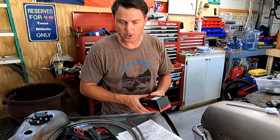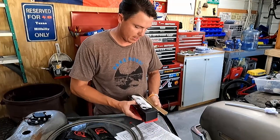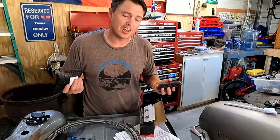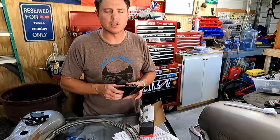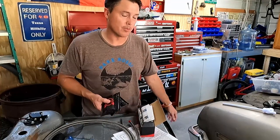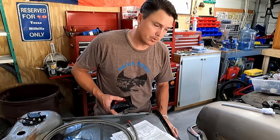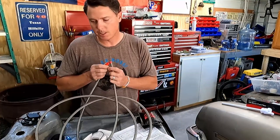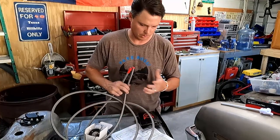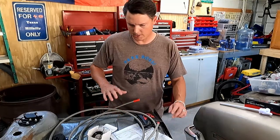Of course, it's an Amazon product. The reason I went with it is it's cheap, but its ratings were very good. Also these fittings — Evil Energy — stupid name, but really good ratings. I'm a little worried because if a car guy buys stuff off Amazon, they're probably immediately reviewing it, not reviewing it a month later. The concern is that it'll leak — well, if it leaks, I'll deal with that down the road. I'm not going to install the filter right now — I'm going to install it at a later date, but I do want to put fittings and connect it to the return and supply. I'll leave it looped under the car and later cut it and put the filter in line.